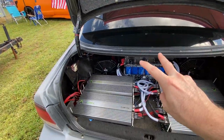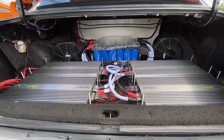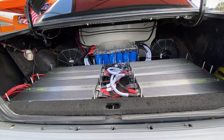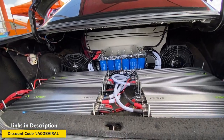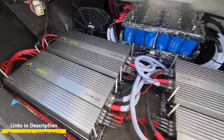And these are at one half? They're at one ohm apiece. Okay. I had eight of them before the show, but I popped three amps. You had eight on here? Yeah, I had two per strap. Whoa. Yeah, about a half ohm per amp. The amps didn't like to do the high voltage and half ohm, but...